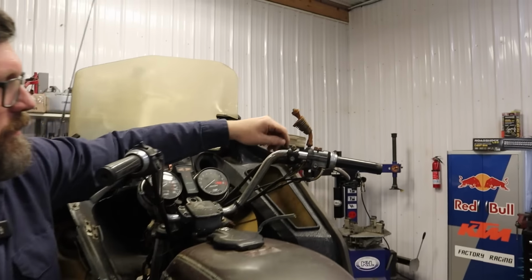Okay, we're gonna make a little concoction here, Dan. ATF. 50% ATF and half acetone. A mixture of half ATF and half acetone makes a really good penetrating fluid. Stay tuned. More chemistry with Craig.